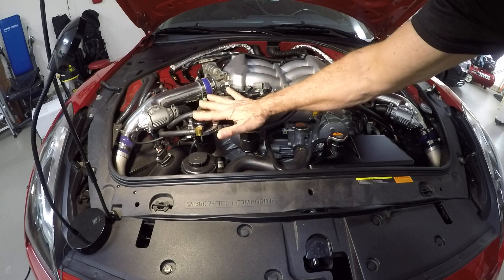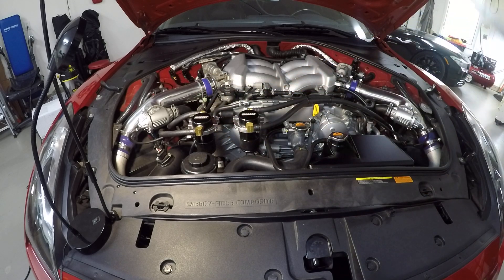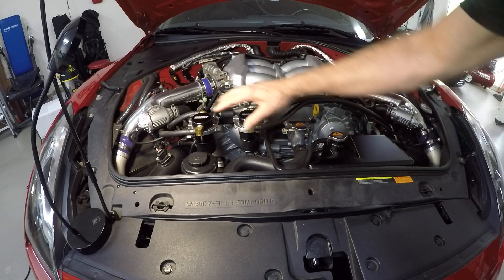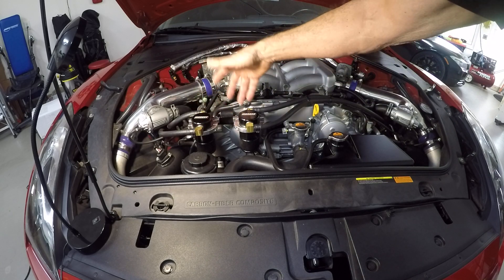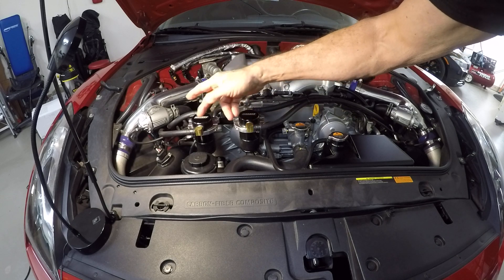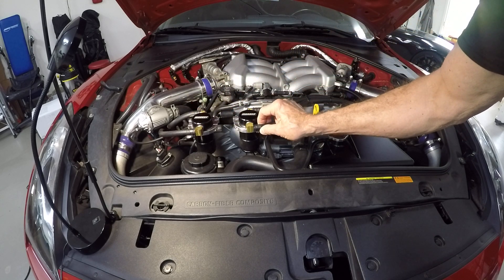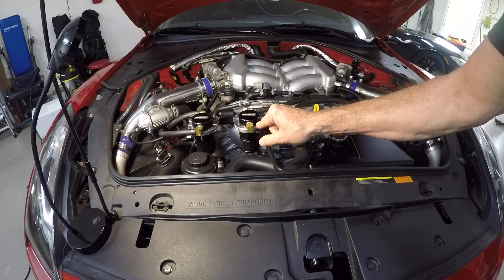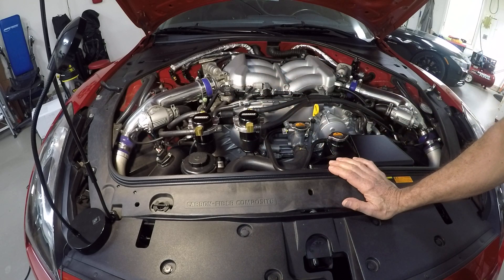On a Subaru, this is the kit for a Subaru STI — item number 85655. You'll see it listed as an oil-air separator for the Subaru WRX STI, but it's obviously adapted for the GTR. It comes with two half-inch fittings to three-eighths — you're going to use three-eighths. So you need to swap out the bigger half-inch ones and go with two more that have the three-eighths barb on the end. Just go down to your auto parts store — that's an easy fix.